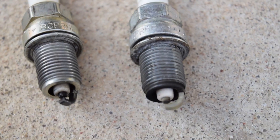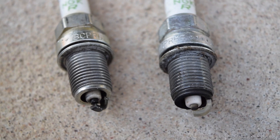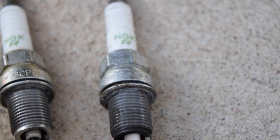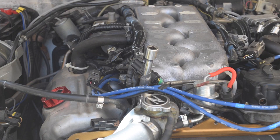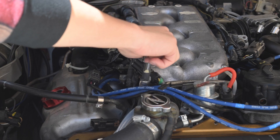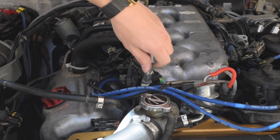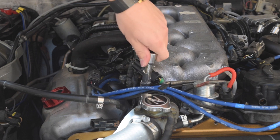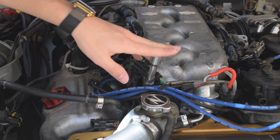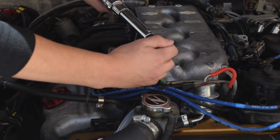When you replace them, use the NGK version — these are the best plugs by far if you're running stock. If you're running extra boost you might do it a bit differently. One important thing: do not put anti-seize on NGK plugs — they already have an anti-seize compound on their threads, and you can over-torque them if you add more. When installing, hand-thread first to avoid cross-threading, since you're not strong enough to break aluminum that way. If you feel any resistance, undo it and start over. The torque spec is 14 to 22 foot-pounds, which is around 210 inch-pounds.